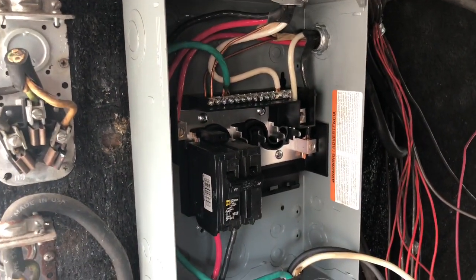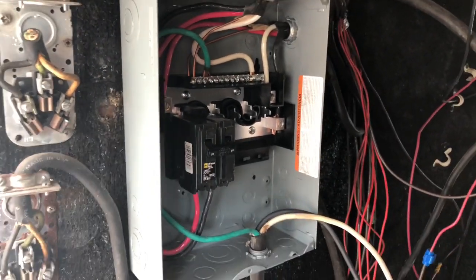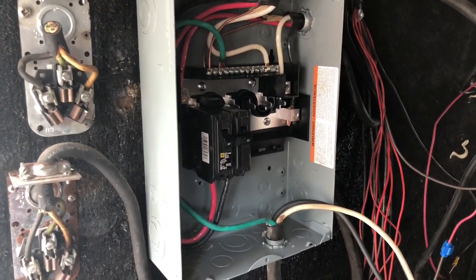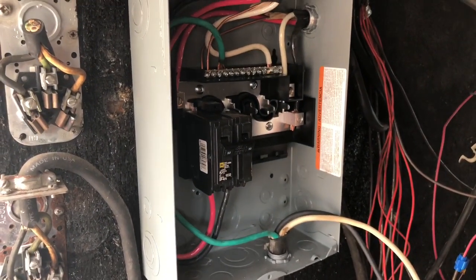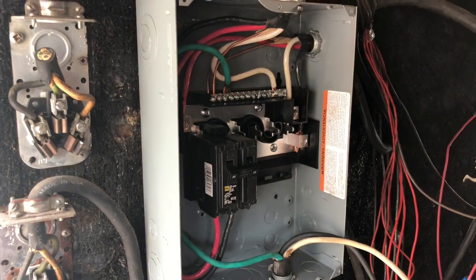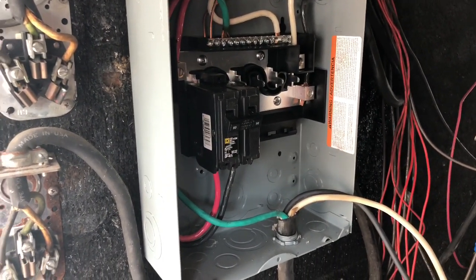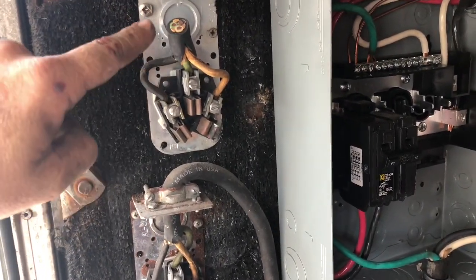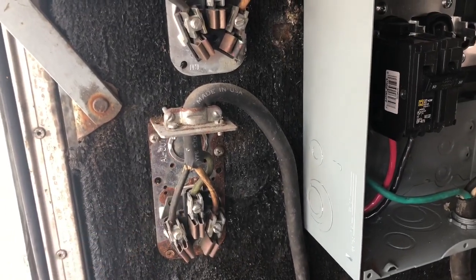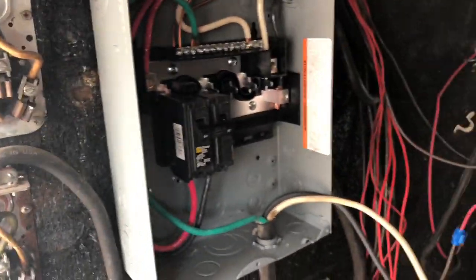I know this isn't engine or tranny or any of that stuff right now, but I wanted to take a pause. We're working on the green '81 Eagle that we have. I just wanted to show you what we do on all of our bus conversions to make a manual transfer switch. We don't like the automatic transfer switches, and we don't like taking these plugs — this one would have been the shore power plug and this one the generator plug — where you just plug your shore power cord or house cord into either one.